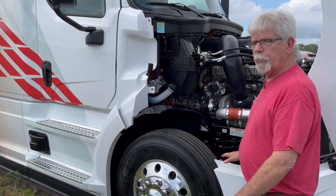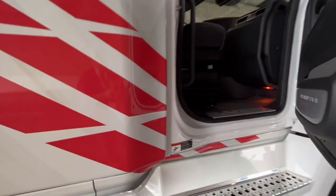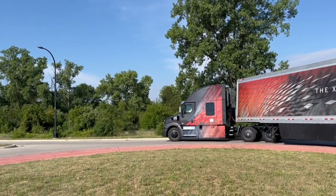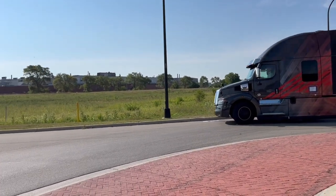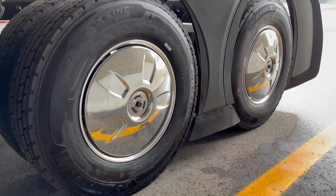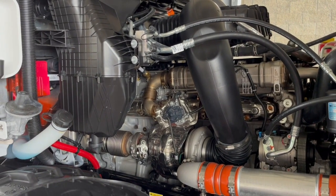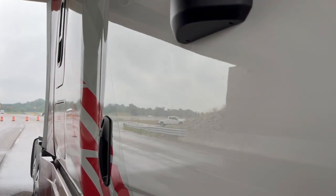That's pretty much all I've got to say about the front of the truck. Let's wrap up with a few more details. It's got a bumper to back-of-cab measurement of 128.5 inches and a front axle setback of 54.5 inches. It's available with a wheelbase of up to 361 inches. Steer axle options are from Detroit, Meritor, or Hendrickson's Air Ride SteerTech axle. Drive axle options include Detroit, Dana, and Meritor up to 46,000 pounds. Engine offerings are exclusively Detroit — DD13, DD15, or DD16 with ratings up to 600 horsepower and 2050 pound-feet of torque. The DT12 is the standard transmission, but drivers can still get manual gearboxes from Eaton in 10, 13, and 18-speed models.